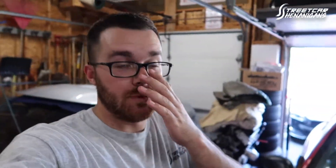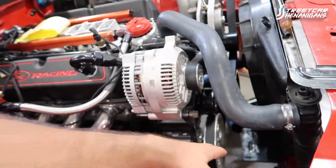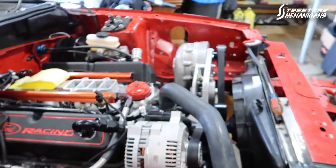I did get a sanding bit to smooth the intake out, so now it's much better than it was — I did it all the way down into the port so it lines up pretty good. No gasket overlap; there are a couple corners that aren't matched perfectly but it's way better than before. The intake is done. The cooling system is near complete — I'm just missing the two cooling crossover hoses in the back, which I know I have on the notch. Belts are all routed, got to mount the catch can, all factory radiator hoses fit fine, rack's in, fuel lines are on, injectors are all plugged in.